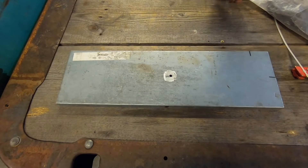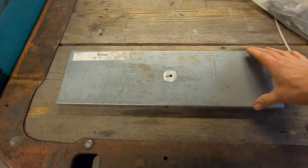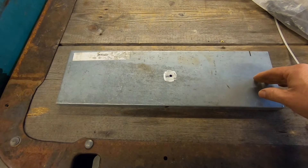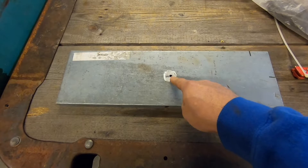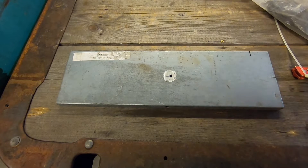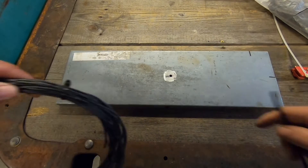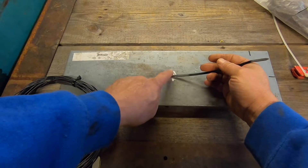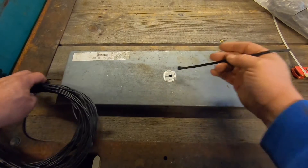Here's a cool little trick I use often — in fact I used it on Oscar here when I was running the taillight wires. Let's say you've got a broad piece of metal and you need to run some wire through there, but there's nothing convenient to tie it to. There are always extra holes in frames from the factory, so here's a little tip to attach that bundle of wire to the frame. Locate a hole that's smaller than the head of the wire tie, or use a big enough wire tie that it won't fall through.